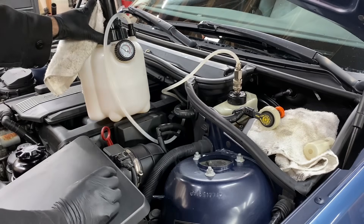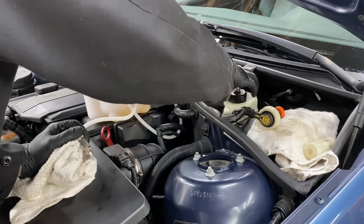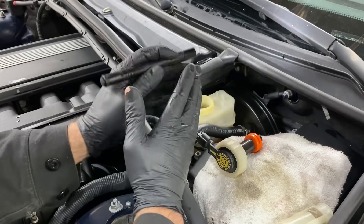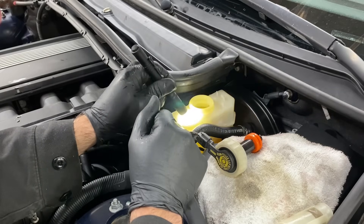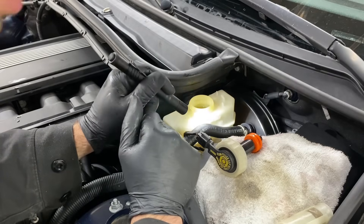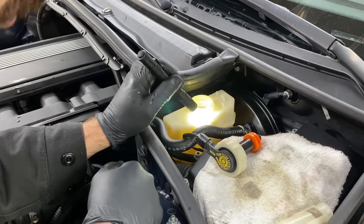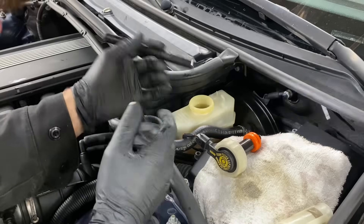Now that all four wheels are bled, we can release the pressure in our bottle, disconnect the cap, and remove our fitting. Our fluid clarity is spot on — it's nice and clear. I could throw the cap back on at this point, but we're going to have an issue in the future when we do a brake service. As brakes wear down, the piston has to push farther out of the caliper to apply pressure to the brake pads. When a car's brakes are low, the brake fluid will be low as well. After a brake flush with the reservoir topped up to the max line, if you do a brake service now, compressing the pistons would cause brake fluid to squirt out of the cap with nowhere to go. We need to evacuate some fluid and get the level about a half inch below the max.